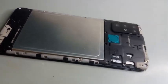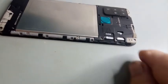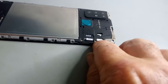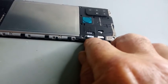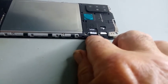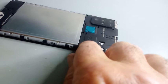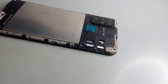In my opinion, the instructions for this aren't terribly clear, so I thought I'd just do a little film to explain it. There's a nano SIM goes in here — that's SIM slot one. There's a micro SIM goes in here, but I only have two nanos. So this little black outline around the edge is a micro to nano adapter — I put the SIM in that, slid it in, and then it worked fine. And here is where the TF card goes. So you can put in two SIMs and a TF card at the same time.